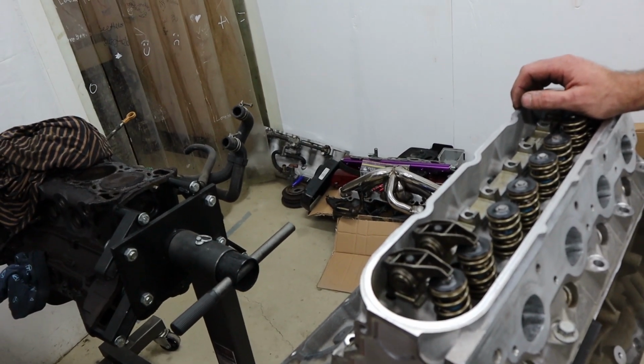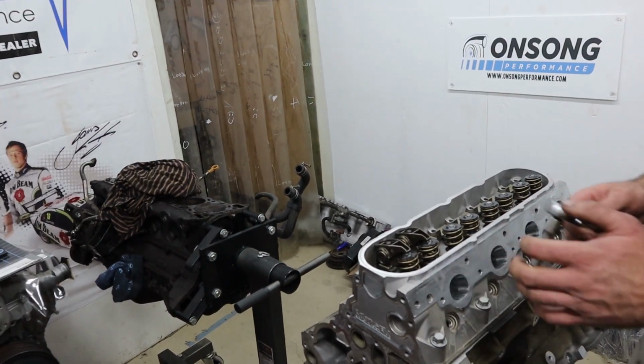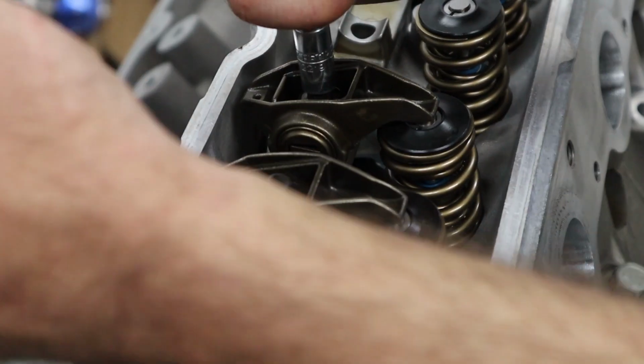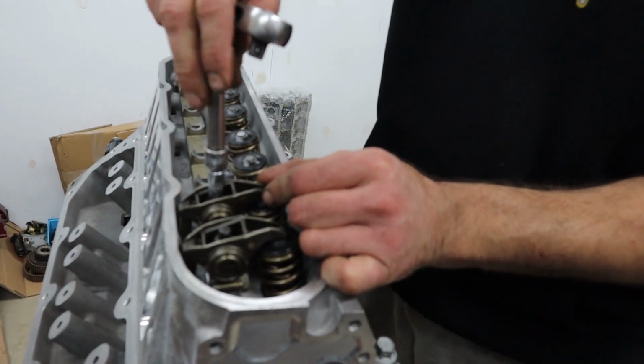So we'll order some of them tomorrow, but an 80 thou wall is what we're going for on this thing. 80 thou wall push rod. Yeehaw! So we'll order some of that stuff and we'll get this thing together properly later on in the week. I'm actually a bit happier about that because this SD card was nearly full. That's why the clips are getting a bit short.